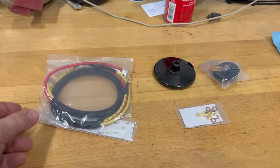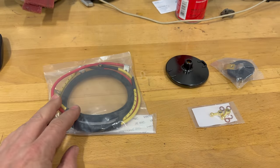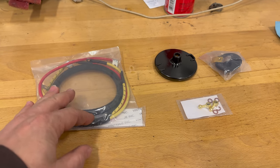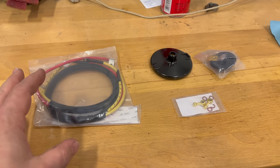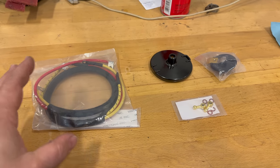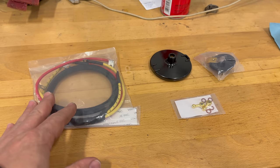Let's take a look at what I got. This is the dash wire harness. The wiring on these cars is kind of broken into two parts: you get wiring which controls the engine, and then all the lighting is a completely separate wire loom. On all of these early cars you could have many different body types, so it makes sense that the wiring is broken out into completely separate systems.